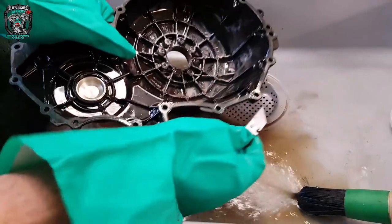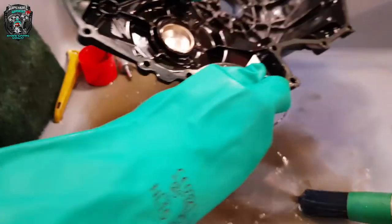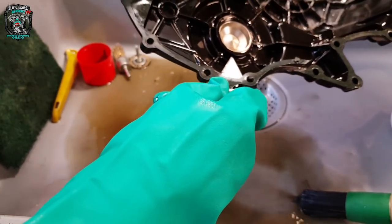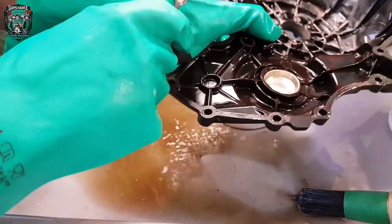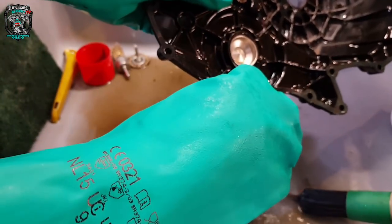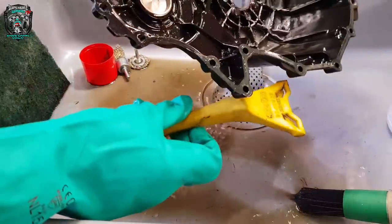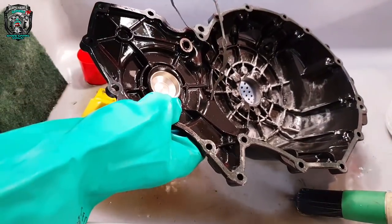The tip is removing old gaskets. Brand new Stanley knife blade — watch you don't cut your finger off. If you can just get it underneath the old gasket, get it started, you'll find that you can wiggle it around and get the gasket off in one piece, or almost in one piece. Obviously some of them are a lot more stubborn. If there are any little bits left, you can use it flat and scrape the old gasket off. Obviously you don't want to remove any aluminium. You can buy posh scrapers — I've got a little plastic holder for a Stanley knife blade. Now I'm going to clean this off, everything else is washed off on the bench, and we'll start reassembly.